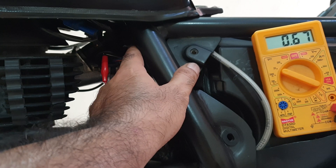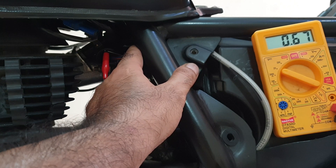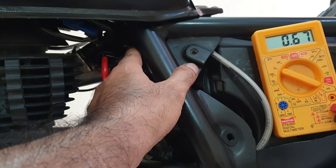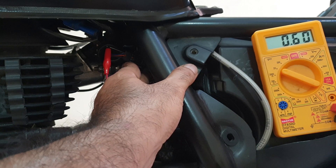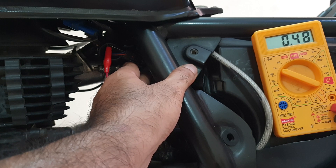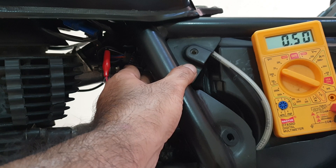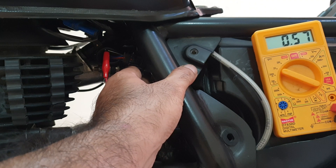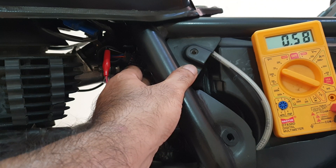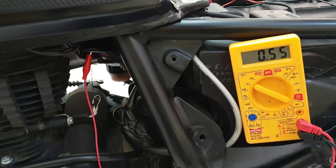The bike does stall sometimes at those settings. Of all these settings, I am okay with 0.6, but I prefer it at 0.55 to be very honest. So I'm going to stay at 0.55 — there we go, close enough — 0.54 to 0.55. Now I'll just tighten it here. That's at 0.55 to 0.56 basically.